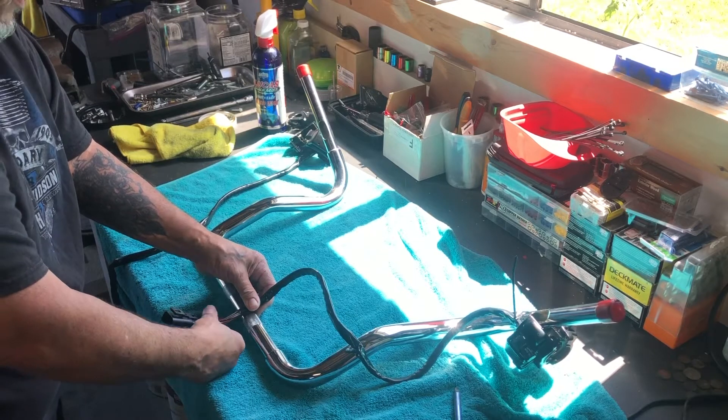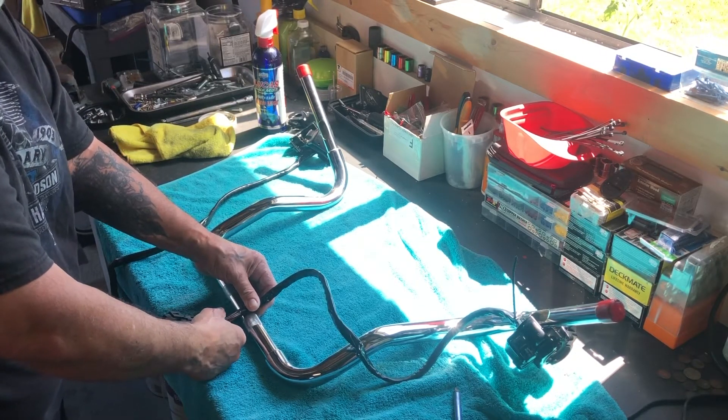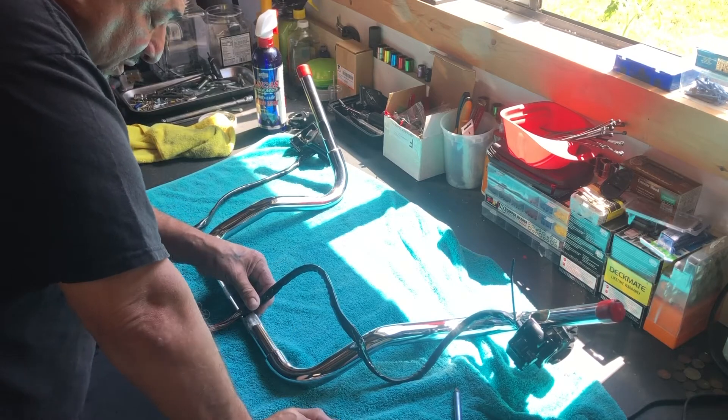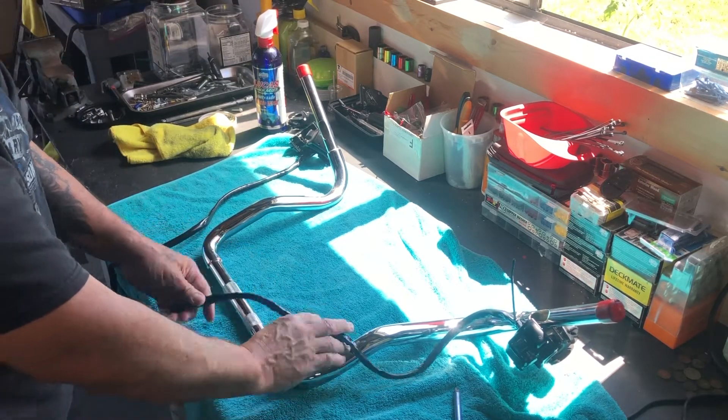You've got about six or seven inches on the inside of the connector, which is fine. I'll reroute the other end of the connector coming from the bike so it'll connect and you'll have plenty of turning. If these were 14-inch bars, I would probably recommend getting new wires or extending your own wires — that's a whole other video. Very time consuming: soldering all the wires, heat shrinking them, and getting a longer vinyl sleeve.